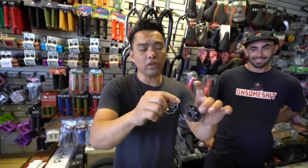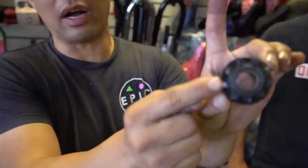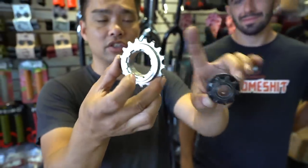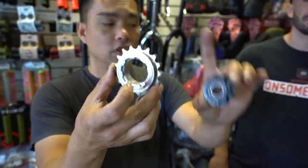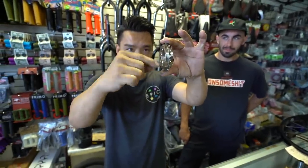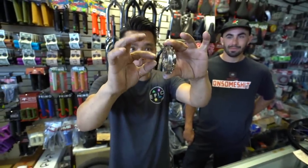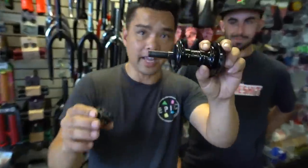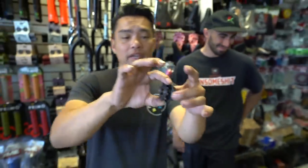So then all the gears are on the inside, and they can make the driver smaller. They can't make this thing smaller because all the gear's over it. So imagine if there was another extension that comes out to here and the gear's right here. They can make it as small as they want because this is an extension of it. Freewheel, cassette. Anytime you see a very small one, it's a cassette. That's the difference. What is the advantage?